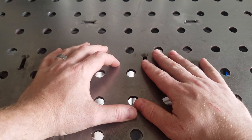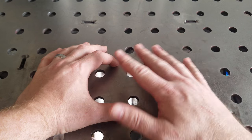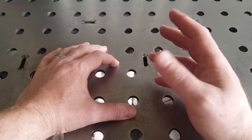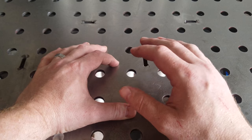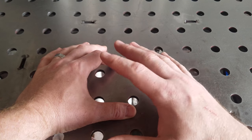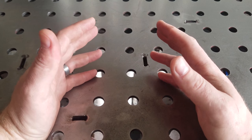I've decided not to put the torque converter back on the minibike, and here's why. With the clutch, takeoffs are manageable pretty much for anyone — new riders, experienced riders, all the same. The torque converter on Project Minibike — takeoffs, not so manageable. Even when you expect it, it still surprises you and it still lifts that front wheel off the ground and tries to dump you on your butt.